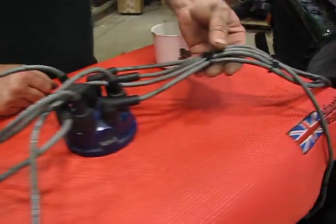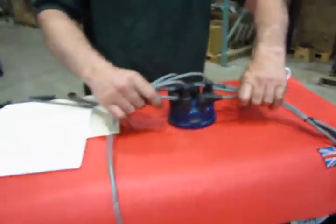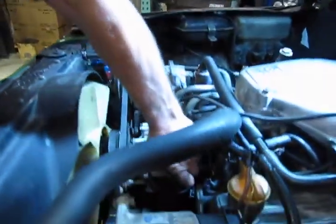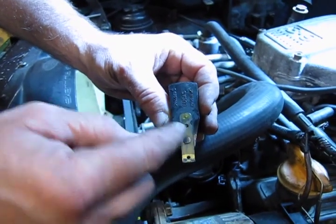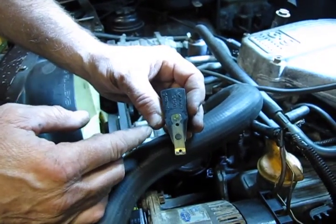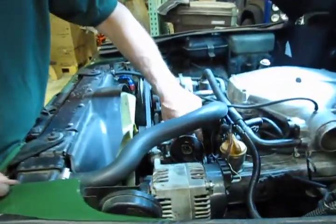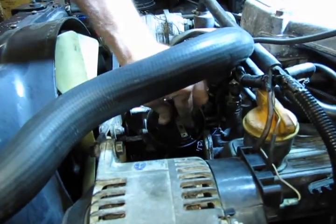You have your small looms — these are homemade, but a lot of your vehicles originally will have a plastic loom that holds the wiring in place — so you have your right and left hand side. You're going to change your rotor, which is nothing more than a pull-out; it simply pops on the end of the shaft — a good grip and pull up. You can see burn marks all the way around the outside, so this has been arcing — that's power being lost through the cap and rotor that really should have gone to the plugs, and that can make a difference in drivability and fuel economy. Take the old rotor aside, take the new one, spin it around until you feel the notch in the bottom drop into the shaft, and it will push right in.